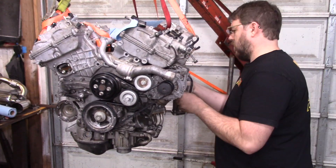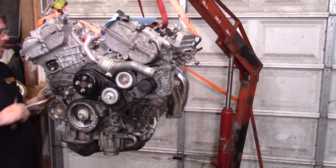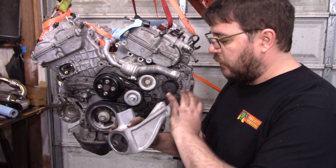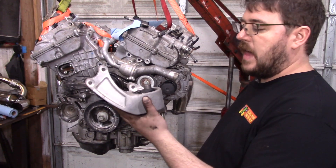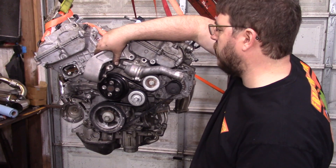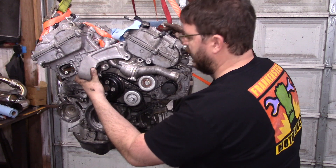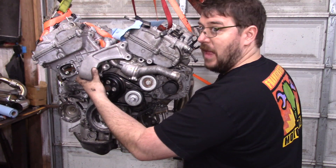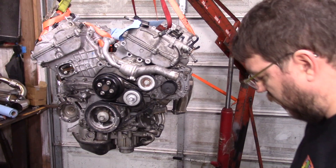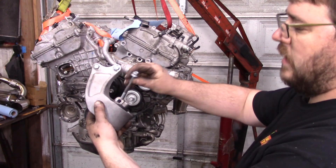And now the headers. Now let's get the motor mount on. The price recently dropped dramatically on these — they used to be $620, now they're $350. The reason is they used to be a fully machined piece and now they are a cast piece. One disadvantage of the cast piece is it has to have draft angle; otherwise you can't get it out of the mold. Previously the fully machined part was a lot easier to get the belt off. You might actually want to take a minute with a sander or file to make it so that you can take the belt off — it only took a quick minute on the sander taking about two and a half to three millimeters off. There are three different size fasteners on this thing: the 55mm fastener that goes up here, the 100mm fastener that goes there, and the 90mm fastener that goes there.